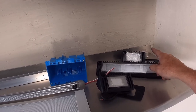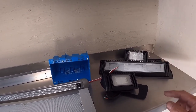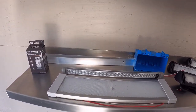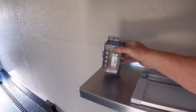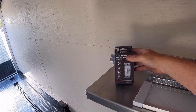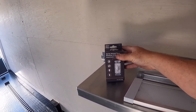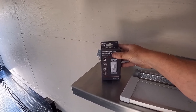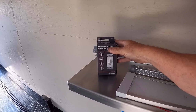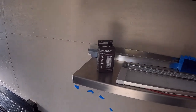This is going into the aluminum skin so there are going to have to be some steps to deal with that - I still need to figure out the spacing so it's secured and doesn't crush the skin. One other thing I like using in an enclosed trailer is just mechanical timers. These are 110-volt timers but they work fine with 12 volts as long as they're mechanical. I have had more than one instance with a standard switch where I accidentally left the switch on and killed the battery.